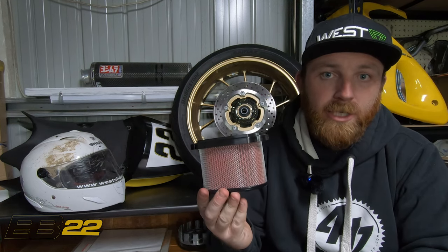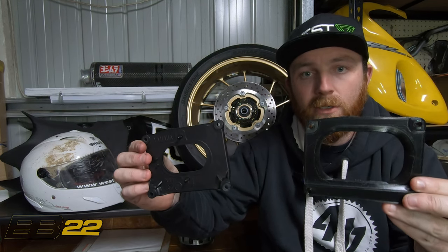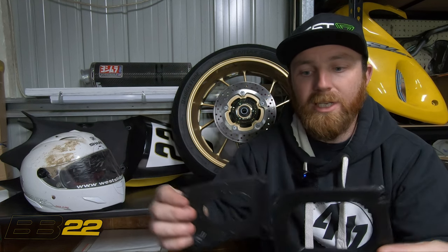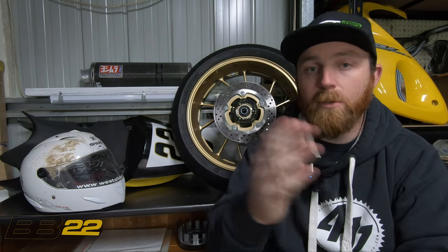While you may potentially feel a little difference at the top end, it doesn't really matter because as a street bike you're going to gain more in the mid-range. Basically the bike likes to breathe. Changing the size of the intake hole on the lid seems to net the most power. Unless you're changing the lid out, you might as well leave the stock air filter in. The DNA airbox lid has a much larger opening allowing greater airflow, and the R7 responds to that.